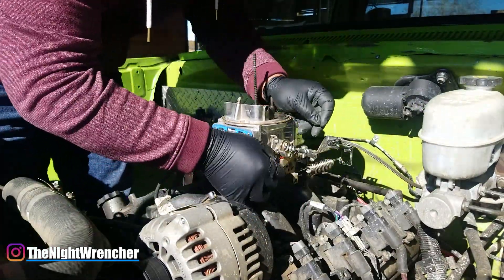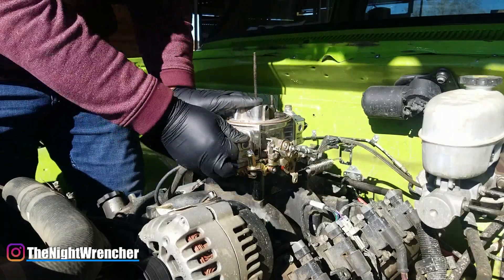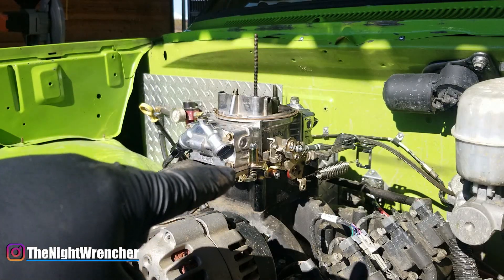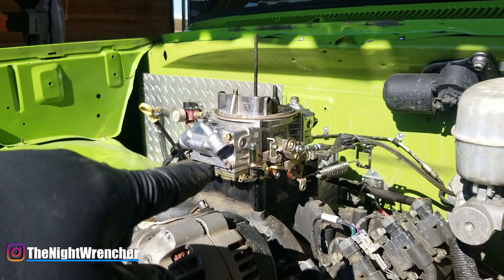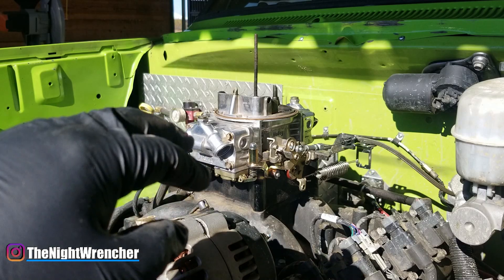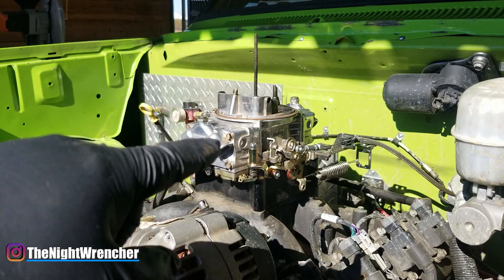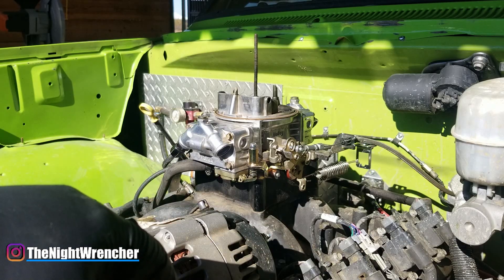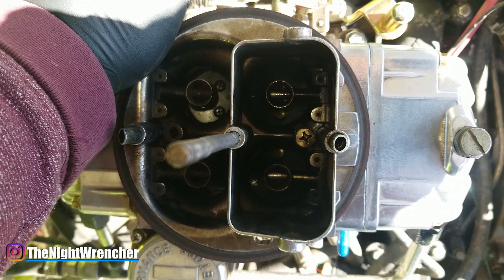I've got it all back assembled. I've got the pump cam installed on position two, because on position one there was way too much preload on the pump assembly — moving to position two gave me plenty of play. To adjust it, you take a 7/16 on the bottom and a 3/8 on top and loosen the nut. That releases a little bit of the spring and extends the bolt downward, which takes up the slack on the accelerator pump assembly. Everything else is perfectly installed. After full throttle, you're supposed to be able to push the pump arm on the housing a little further down, and I did check that. I'll be making another video on adjusting accelerator pumps, but for now everything looks correctly installed.